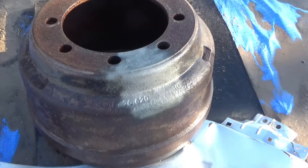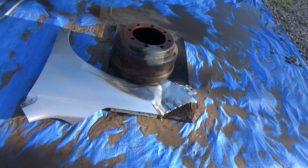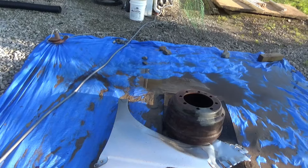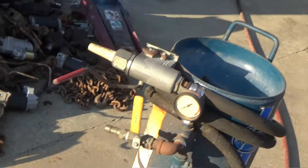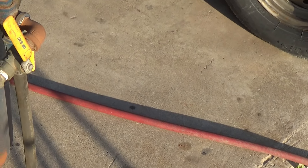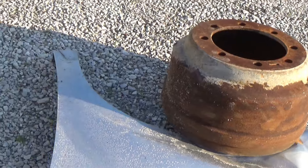It does a fine job on the rust. One major advantage is it keeps all your sand right here — you don't have to wear breathing protection, though eye protection is good to have. Your sand stays right here and you don't have much overspray like you do with a dry sandblaster. I'll go over and do a little dry sandblasting with the pressure pot to compare. This pot blaster doesn't have as big a nozzle as the wet sandblaster does, but the dry blaster seems to be more abrasive — we'll see how it does on the fender.